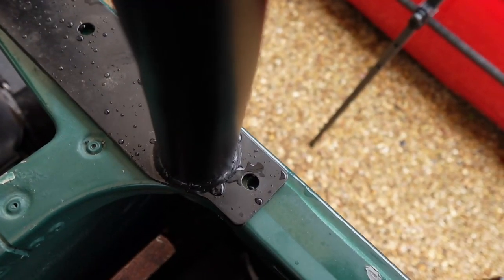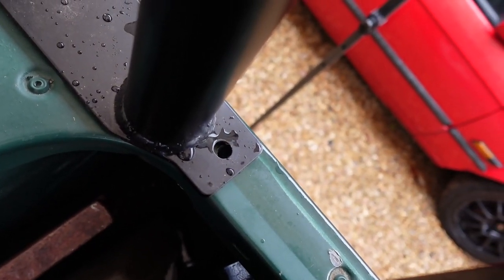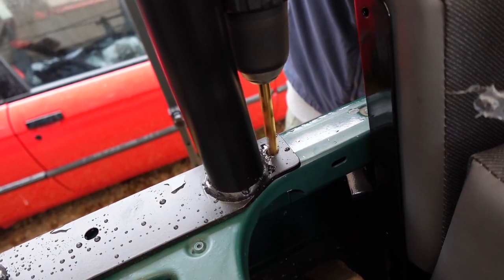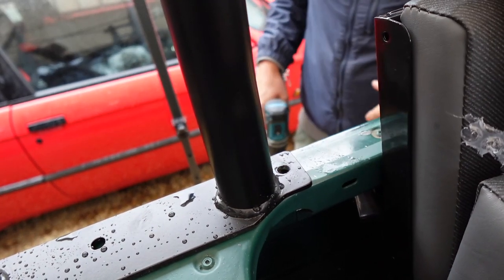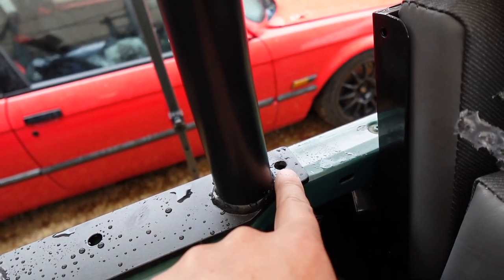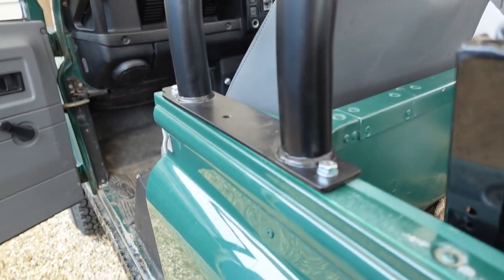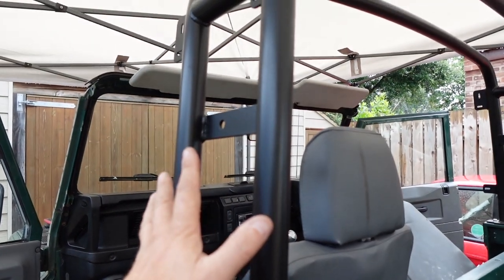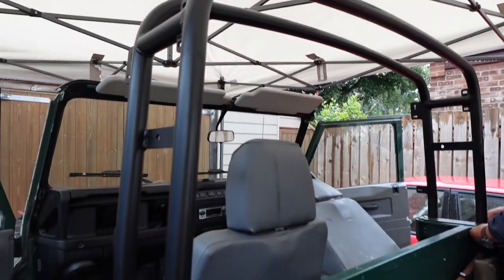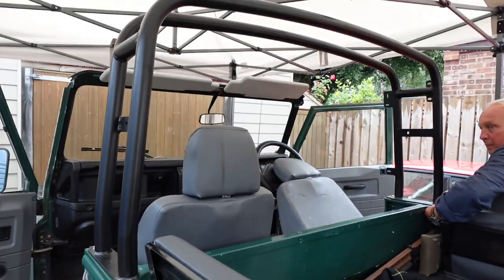There's not enough movement. Sometimes you could get a centre punch in there to wriggle and manipulate it over a bit, but that's going to be too much to move over, so we're going to have to re-drill that. We'll paint a little bit of paint in there to protect it because we've gone through the e-coat and the paint on the truck. We'll tighten all four of these up tight — that means we've got one point to work off, and then everything else can be adjusted from this point onwards and backwards.